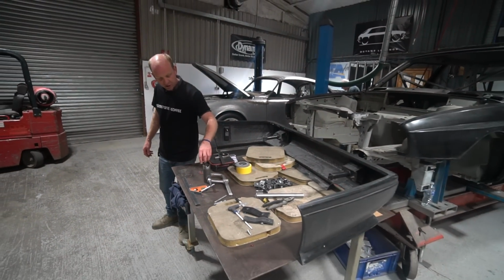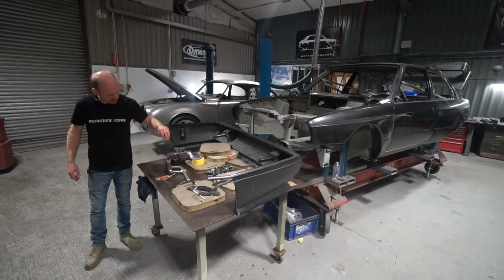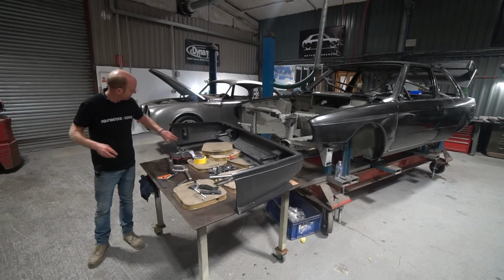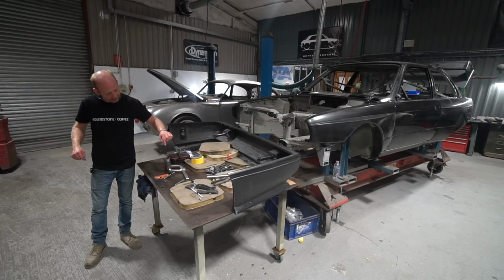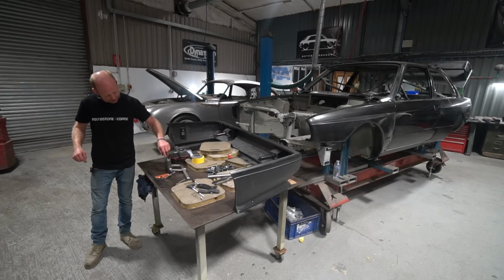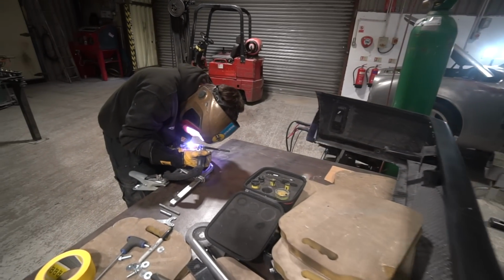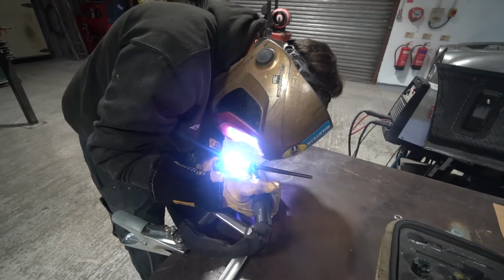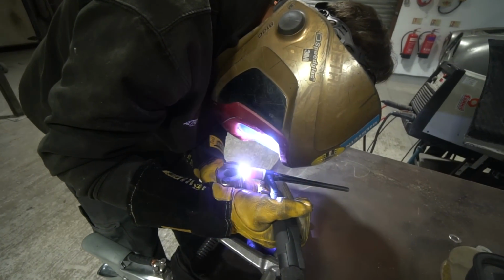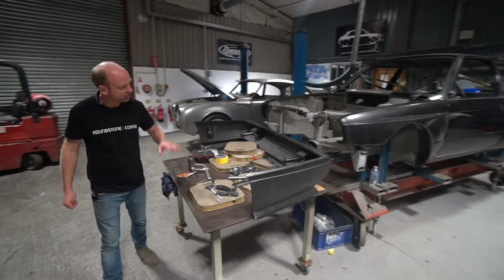It just makes it a little bit easier to weld. I'm not going to go into all the detail of the design of it now, but there's basically a little outrigger assembly that's going to carry these bumper mounting points and fit through the quarter panel, and it's made in two pieces that need welding together, and those are aligned by this little jig, and the little cutouts in it enable him to get the TIG welding tacks put on, enables it to be tacked up to start with, and then it can be taken out of there and fully welded after it's been tacked. So that's what that was about, and that's what's going on there.